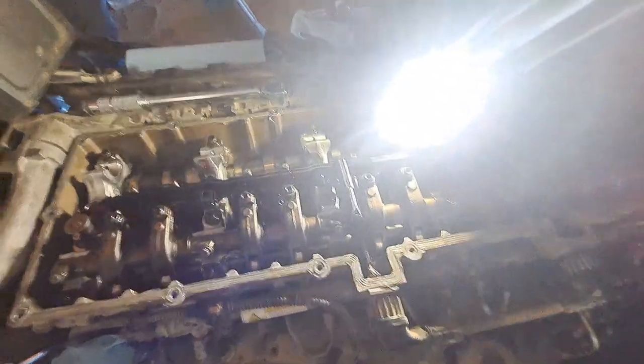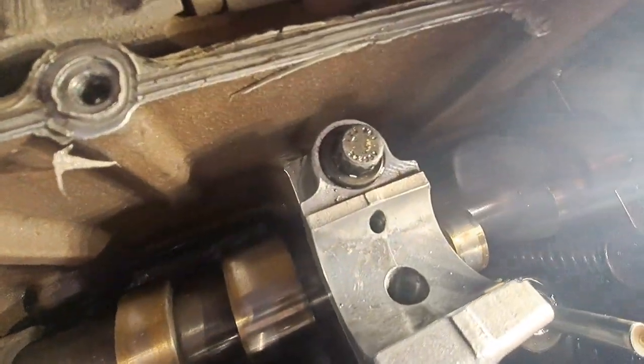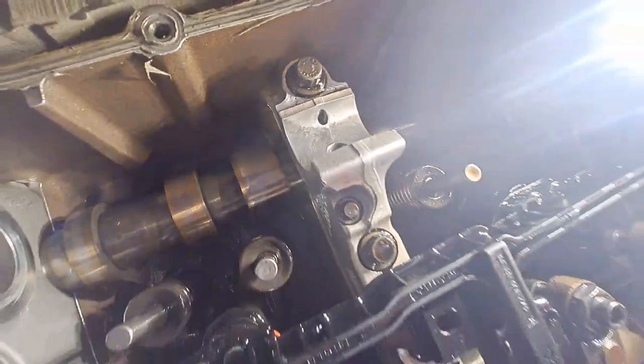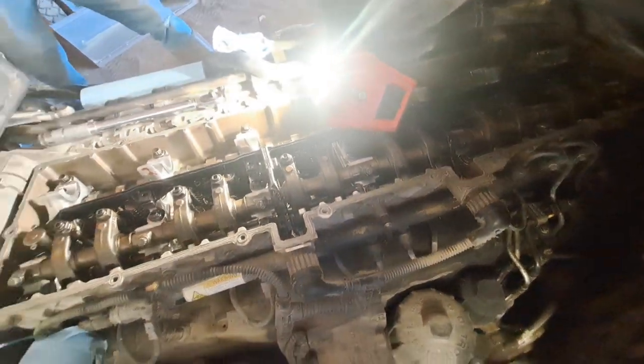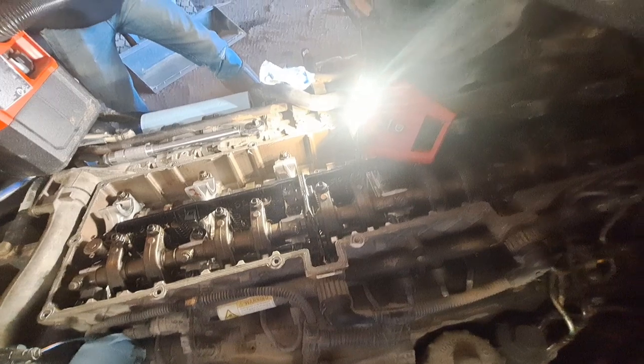What we got going is we're drilling these out. This is what's stripped — that's a 10 millimeter. It's bigger than that at the top, but 10 millimeter thread down in there. They use helicoils from the factory. Anyway, it pulled one — that's one, two, three, four, five, and six. The threads pulled on those three.